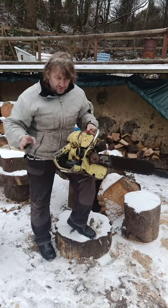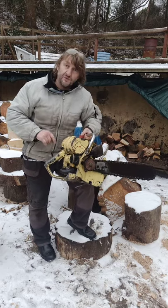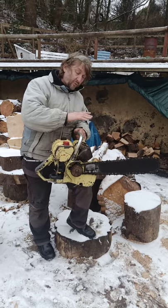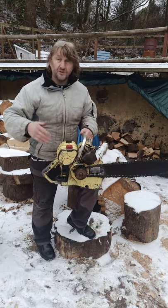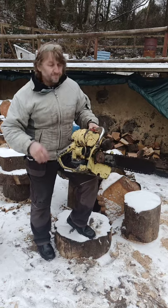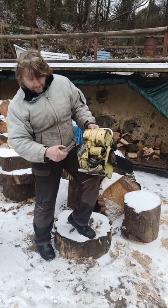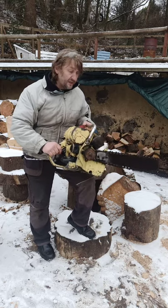So the long story short was that I like to at least have a look at the saws if someone's really genuinely interested, and so I had a bit of time. I have taken out one of the old Champion plugs that was in here and put in one of the very popular B6HS, one of the steel plugs for their early 1960s 70cc engines for like the 07 and the 07S. Changed the fuel line and cleaned out the tank and took out the jets and just gave a sympathetic blowover and put some carburetor cleaner on. Unusual carbs on the Clintons, the early saws, that's a Carter carburetor.